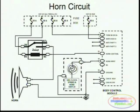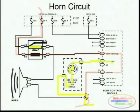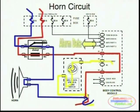The horn circuit is important because many times you actually have to troubleshoot the data path that has to do with the anti-theft system. Here we see how the actual horn switch goes through — shown in yellow — the clock spring, and an actual signal or ground pulse is fed into the body control module. This generates an electron path through the red current flow side, which activates the relay and, in turn, actually activates the horn. The horn is activated by the relay, and the relay is activated by the actual module.